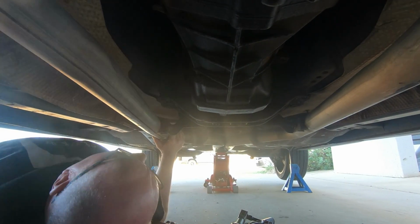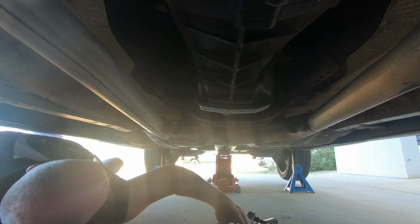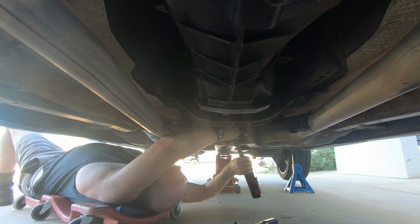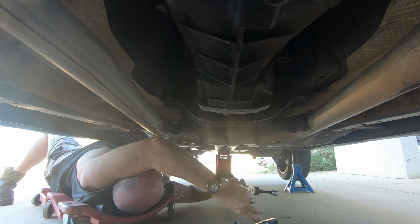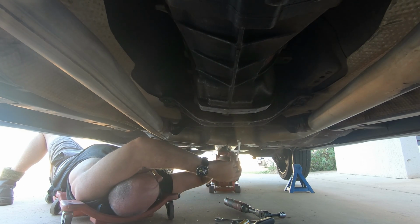Okay, this is pretty hard to film obviously, but disconnect the two flanges of the exhaust so the header pipes stay in the car. Each exhaust will be slightly different. Fortunately mine have the flanges there at the back of the gearbox.